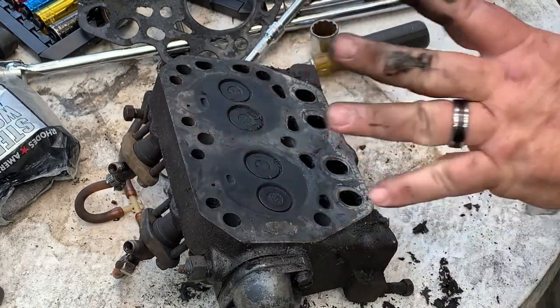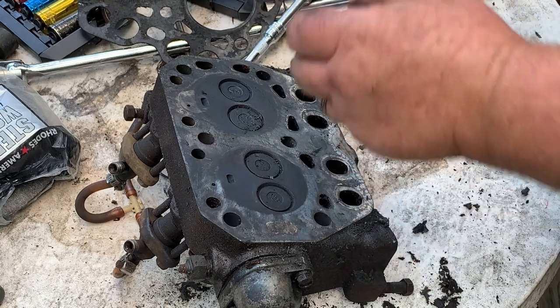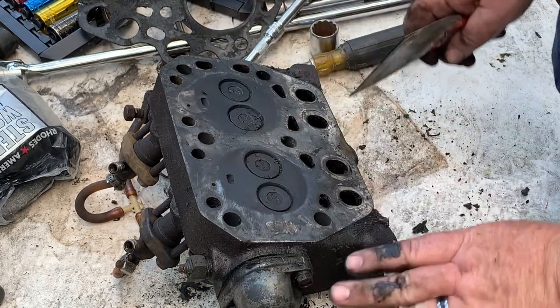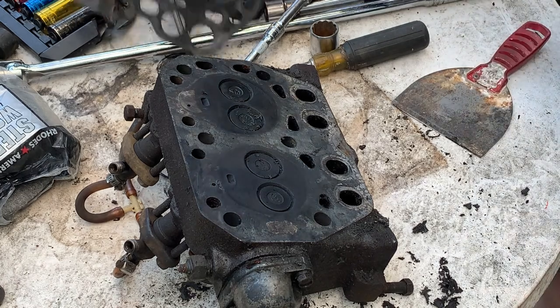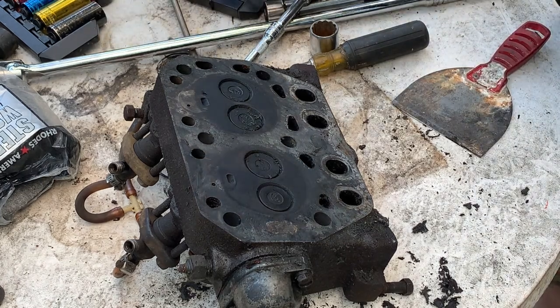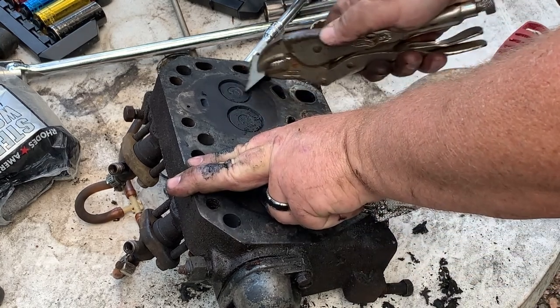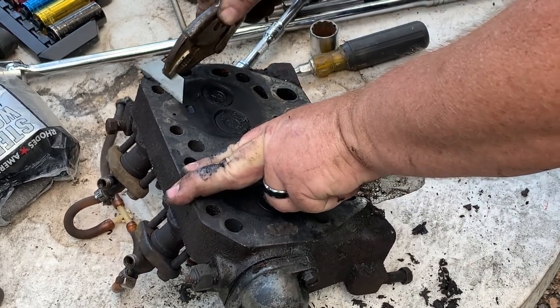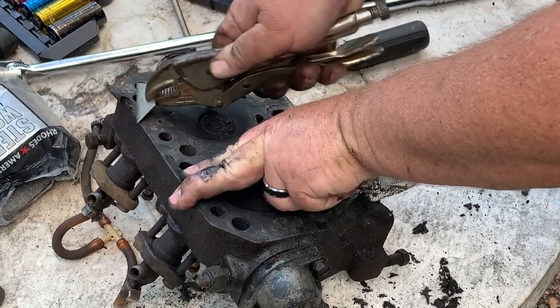In fact, when you're putting the oily bolts down into this, you only want the oil on the bolt and down in the threads before you do that, and then the surface clean. Use the thinner and everything else. It's got to be as clean as possible, grease free. Razor blade. This is the way it's done right here. Look at that. That's the way it's cleaned.